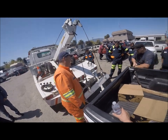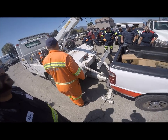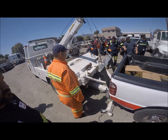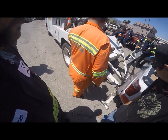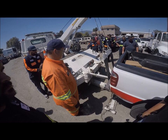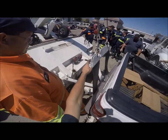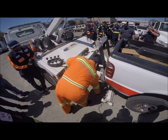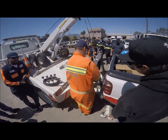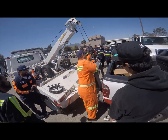Would you guys think you'd wrap it on the hook down there? Yeah, you're good. So then we'd put it in neutral and take the brake off before we lift it off the ground. You want to get that chain on there before you start yanking all the straps too hard. We're going to take our chain up to the top piece plate with a little bit of slack so it doesn't pull tight on the buffer. You've got to do something with the rest of the chain so it doesn't swing and hit the car. Some guys will go across to the other side of the chain, some guys go up here — whatever you want to do.